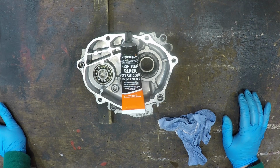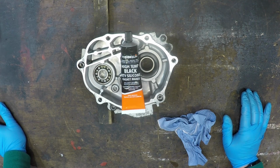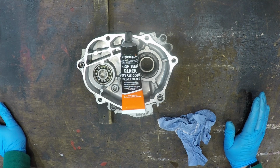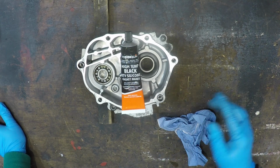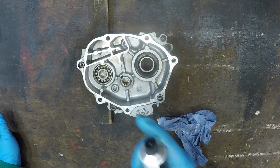but you only put the bolts in hand tight, leave it for an hour. I might leave it for an hour and 10 minutes because it's quite cold, and then torque it up. So there's an actual sequence for doing things. So I'm going to get on and put the silicone on. Well, no, I'm not. I'm going to clean the face with brake cleaner, which is over there somewhere, and also clean the face of the other half of the drive. Yeah, that's going to be terribly exciting.